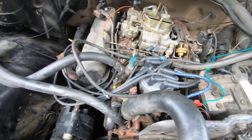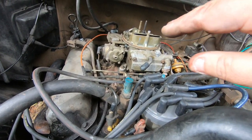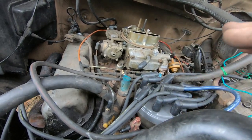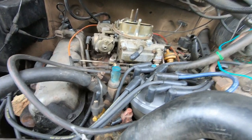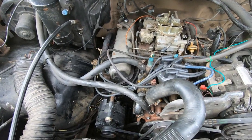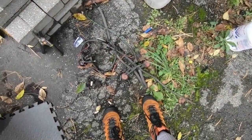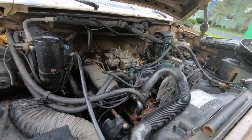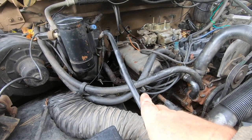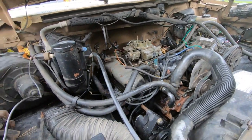I think that's really about it — she runs like a champ now. As good as it's gonna get without pulling the carburetor for a rebuild. I think there might be a small issue with the accelerator pump because sometimes when you hit it you get a lag, and that's usually the accelerator pump. But she fires up and runs great. If you've got any questions, ask. 87 F-250, 5.8 liter — vacuum line removal and throttle kicker adjusting. See ya.